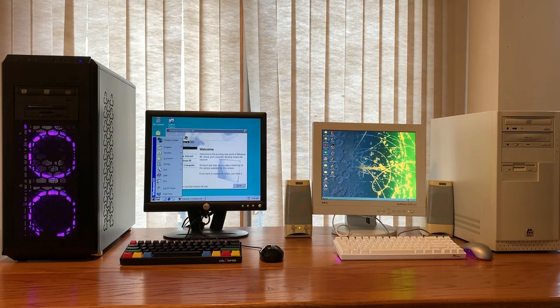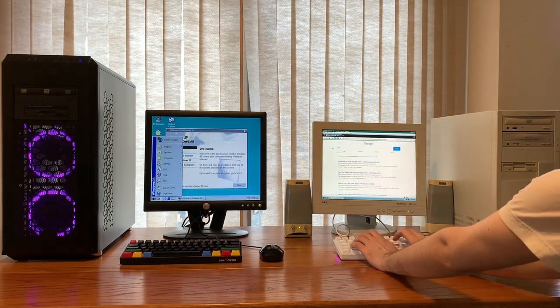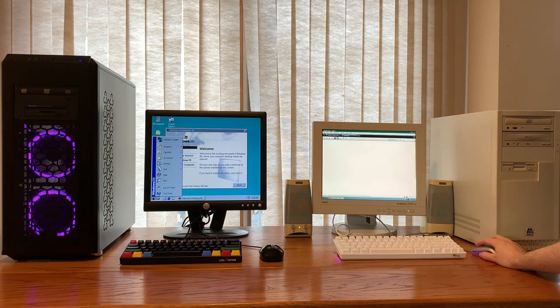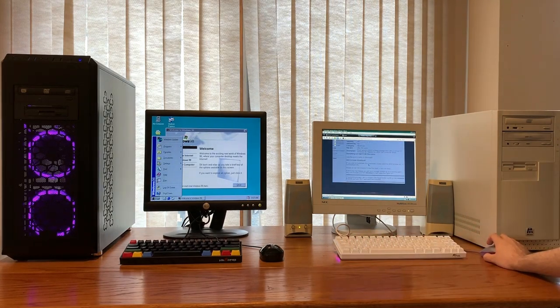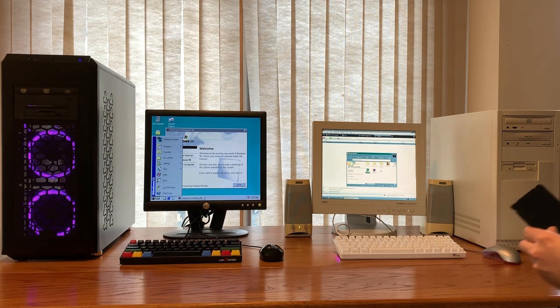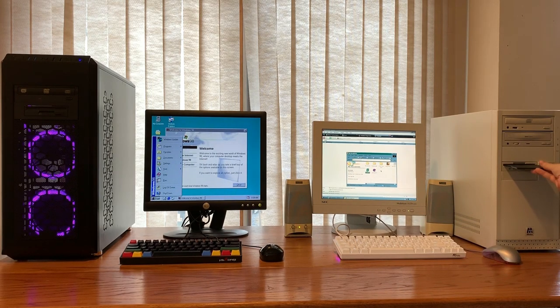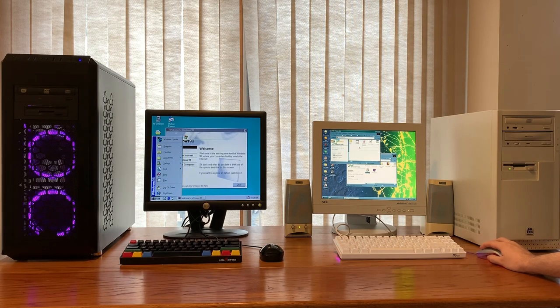We aren't done though. I'm going to have to download the USB driver for this purple PC to actually get drivers loaded on. So I'm doing it the right way. We're going on the internet in Opera on the beige Windows 98 PC and navigating to Vogons, where we are able to download it. I threw it onto a floppy disk. The tool is called NUSB. It's easily downloadable. I've linked it in the description.